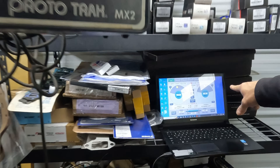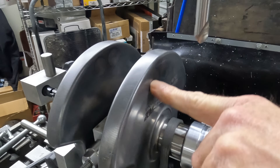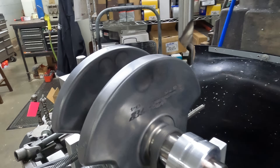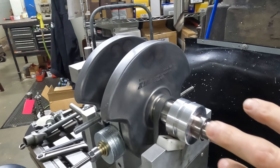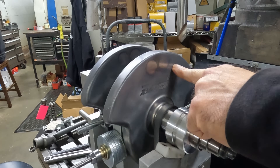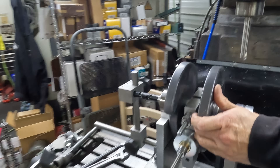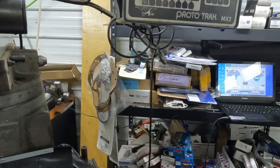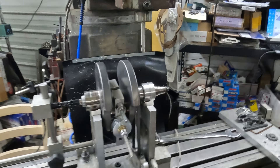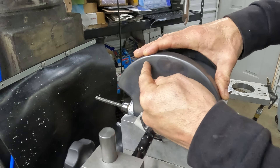You can see it turn green. Right there on the right side, it wants a piece of Mallory. We've already got a piece of Mallory and it ain't quite centered — those two pieces are to the left a little bit. What we're going to have to do is put probably a half-inch piece here and a half-inch piece here to work this side out. The other side needs so much that it's asking for two pieces, so we'll end up putting a one-inch slug on this side and a one-inch slug on this side.